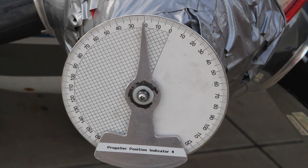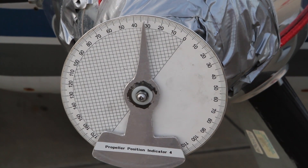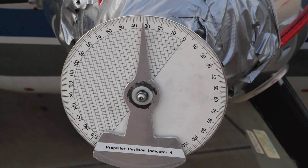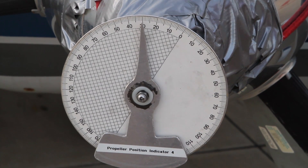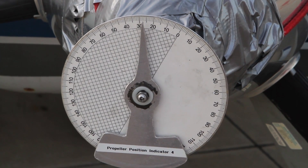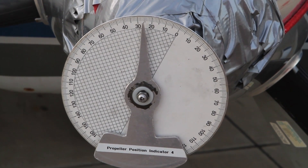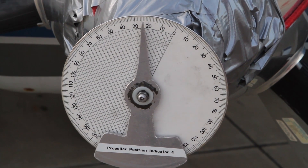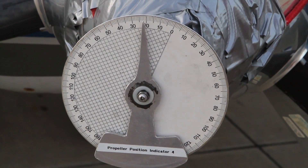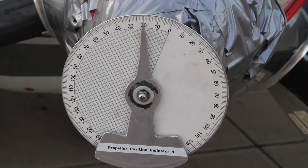So it is timing time once again. With the timing light still installed, we need to rotate the propeller in the opposite direction of rotation so that we don't have any gear lash and we get as accurate a measurement as possible. Now we start tapping it forward gently in the direction of rotation to bring it up and see when the timing light sounds. If we did everything correctly and accurately, the timing light will sound at exactly 20 degrees before top center. And let's see how we did — it is exact at 20 degrees before top center.